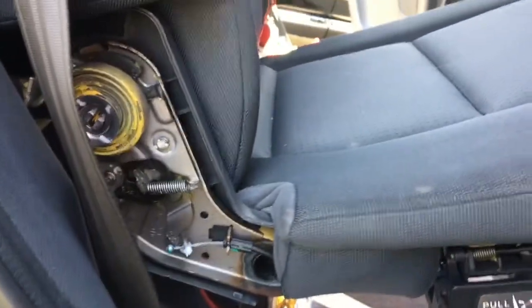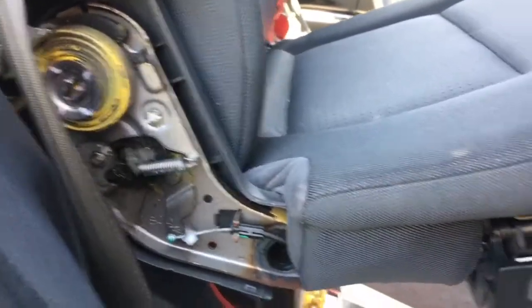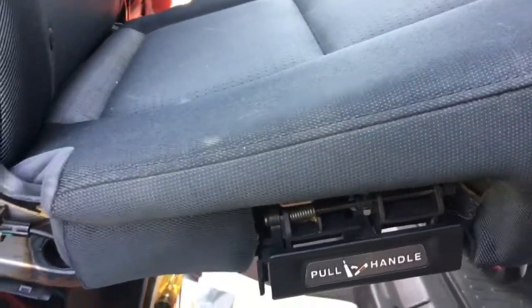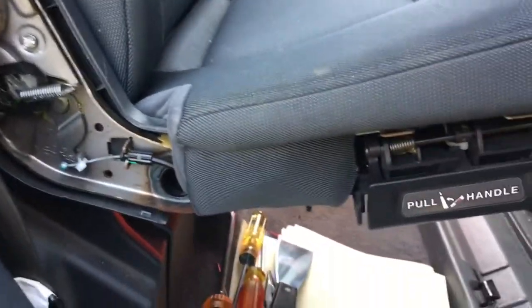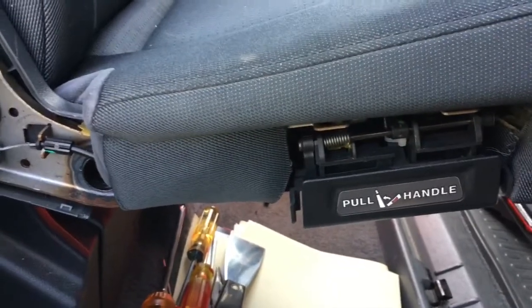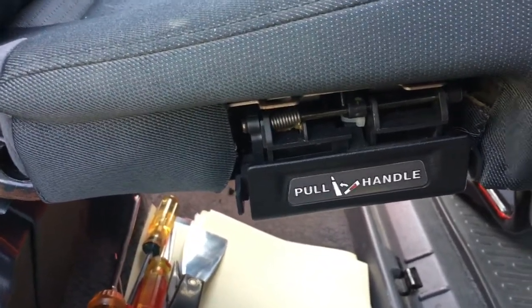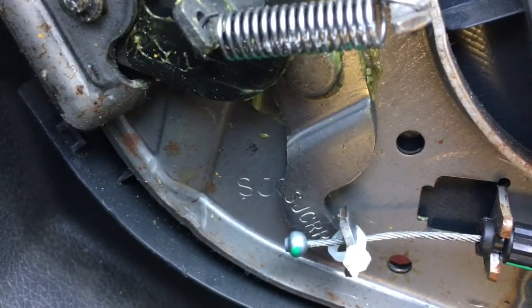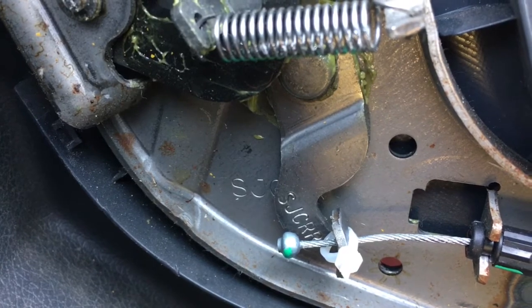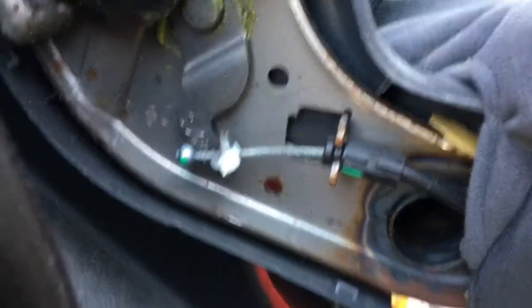I'm working this backwards. We have a Honda Ridgeline here — the right rear seat, a 2007 I've had since new. One day I went to lift the seat and it wouldn't lift. That happened on the left side years ago and there was a several-hundred-dollar fix, but I just took it apart, found the cable had popped loose out of the slot at the handle, and fixed it. The next time I put it back, I added a small zip tie around it. The cable could still move freely, but eight years later that side has never popped out again.